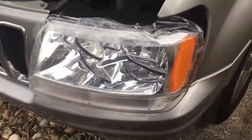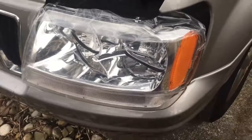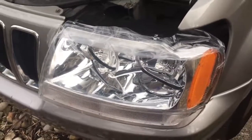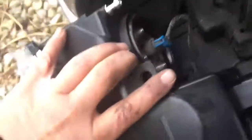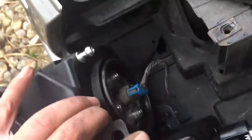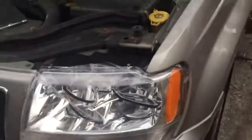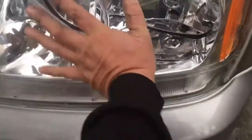Okay, I'm back. Since I'm doing this one-handed, I went ahead and wired everything in, but I just wanted to show you the final installation, which is putting the lenses back in the vehicle. I've already gone ahead and put all the bulbs in — not a big deal there. You can see these pins here that I was talking about earlier. You just go ahead and line them up, and you can see how that just slides in there. You line those up, give her a good push, and snap, snap, snap — that's all it does, that's how it holds in.